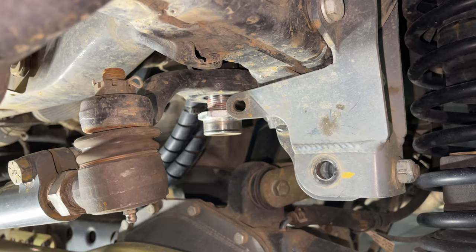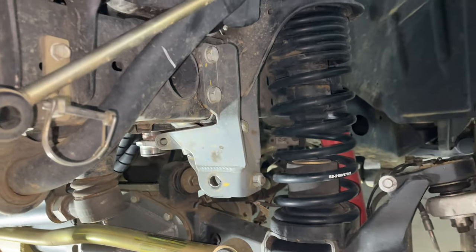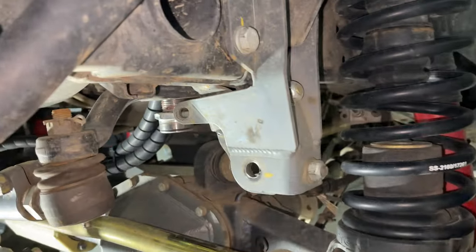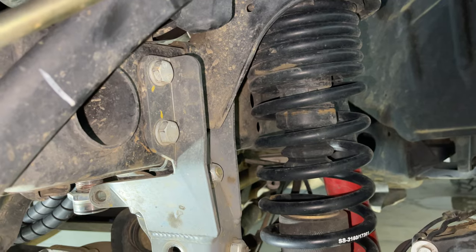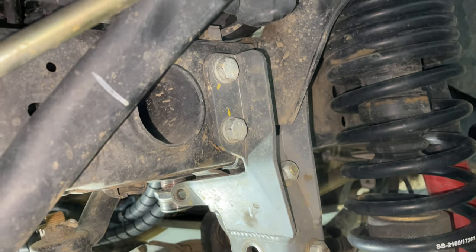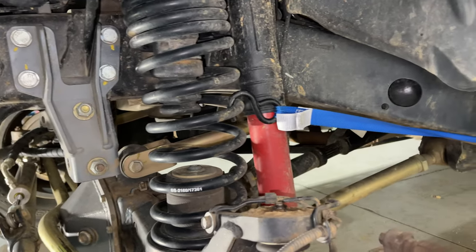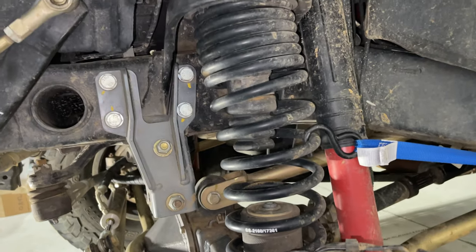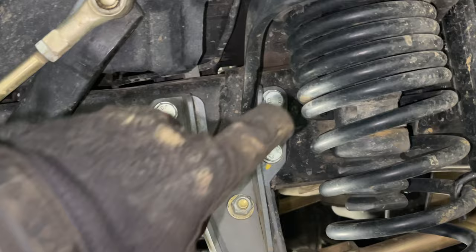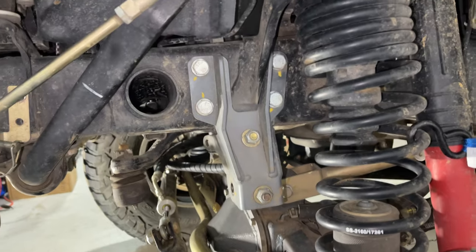Now that we've got that nut loosened up, we'll pull the tire to get the brace off. You don't need to pull the tire, but I'm going to just so you guys can see it a little better. When I installed this the first time I did have to put a little ratchet strap on the coil spring to the frame, just to bend it back about half an inch so we could get the top right bolt. I hooked it to the frame there — that gives us plenty of access to that top right bolt. I'll pull these two 18mm bolts on the Synergy brace and then pull the box bolts.